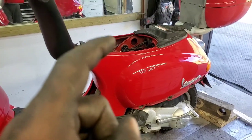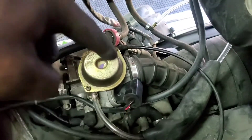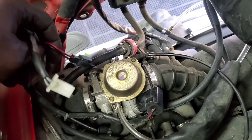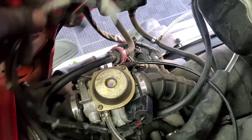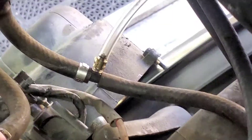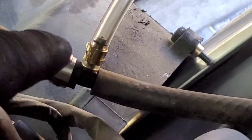Your carburetor is absolutely fine. The auto choke was originally my suspicion for the fault because I see that this is aftermarket. It's not plugged in yet. I actually haven't even finished putting your scooter back together, even though I've got it solved. It's the end of my day and I just kind of want to go home, so this will be ready for Monday. I just wanted to give you a walkthrough. So initially, this vacuum hose, which I've zoomed in on, was the problem. The factory clamp that they had put on it was too big and the hose was too big as well.